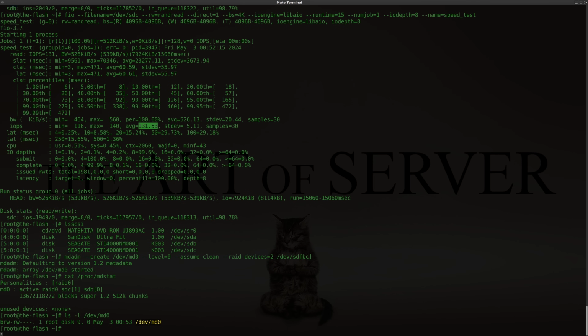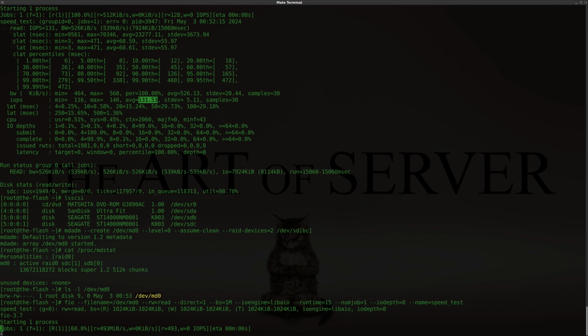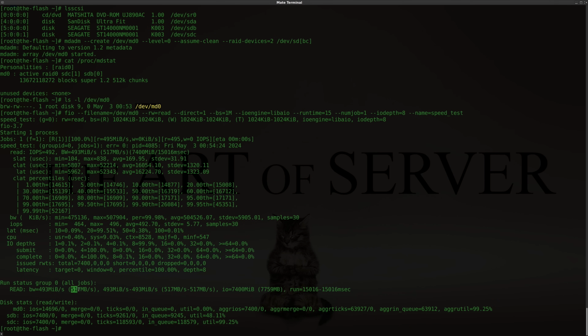All right, so let's go ahead and run some of those benchmarks again. Let me see if I can just call one back here. I want to do the read test. Okay, so we'll run the read test on md0. Now remember earlier we saw something like 270 megabytes per second on one side and like 250 or something like that. So I'm hoping to see something like the sum of those two, right? So somewhere above 500. Let's go. All right, bandwidth 517 megabytes a second.